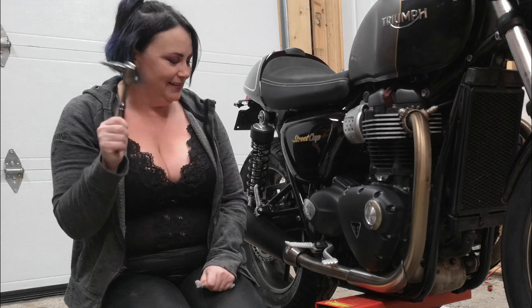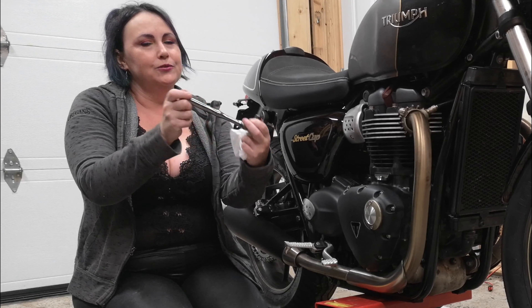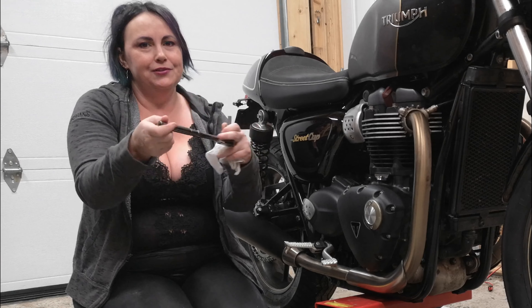So I've got my ratchet with an Allen key wrench — it's an 8mm. We put this up under the bike into the oil pan plug and loosen her up, and then the oil pours into the pan. Then we move on to the tricky part: getting out the old filter. With this new filter, the reason we went with it is because it's got this nice little nut on the end. Once it goes up and locks in, you've got that nut to help you get it out or tighten it into place, whereas the one that's in there now doesn't have this.